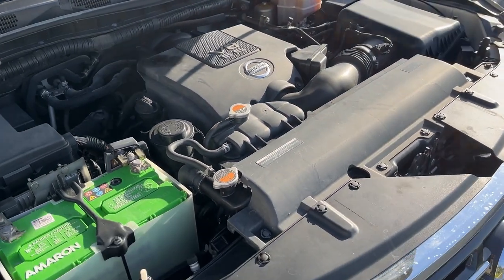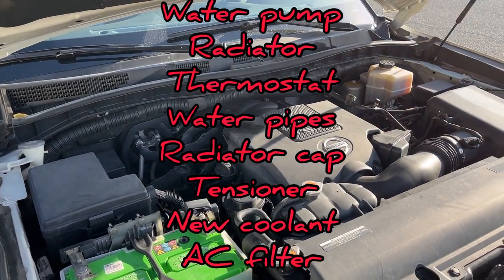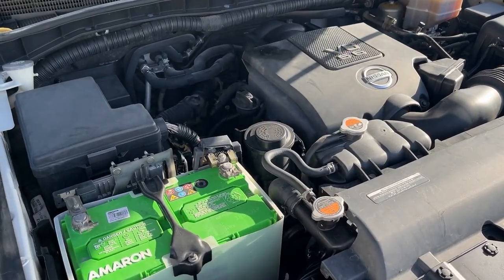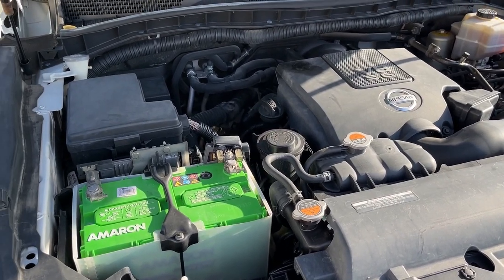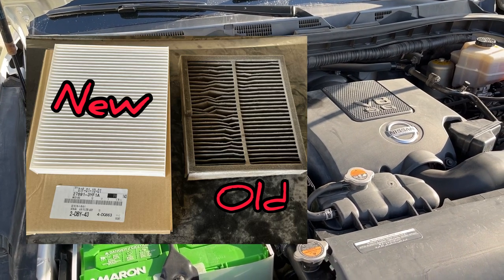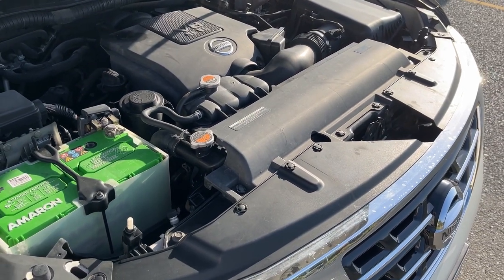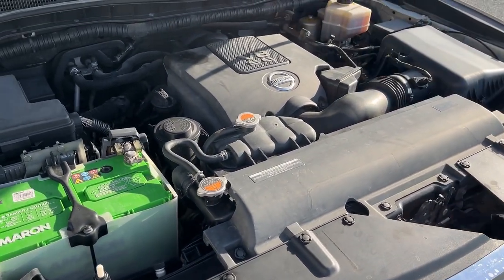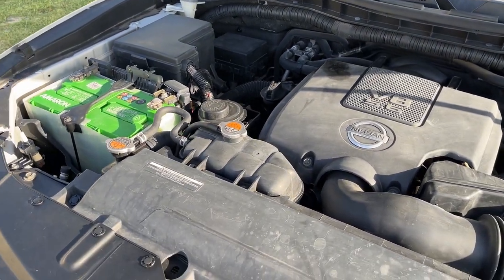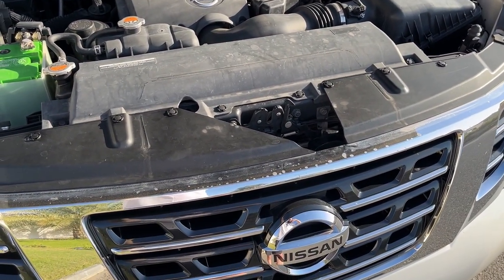It's already dusty after one day. Here is the list of what we replaced — the car has been fully serviced. One more thing for Nissan Patrol owners: keep an eye on your interior AC filter, because once it gets stuck, the AC stops cooling and stops blowing. We changed the filter and everything came back into place — no need to refill the gas, the gas was fine. Thank you for watching guys, thumbs up for Patrol owners.